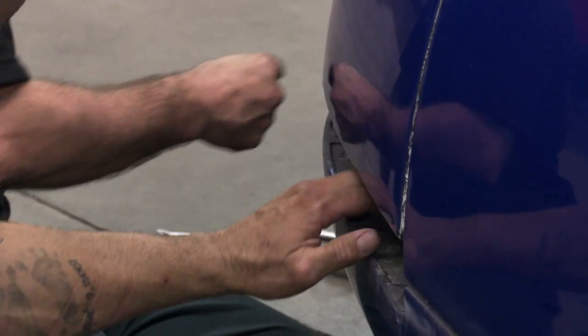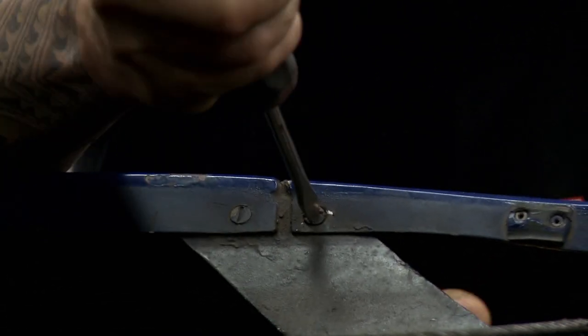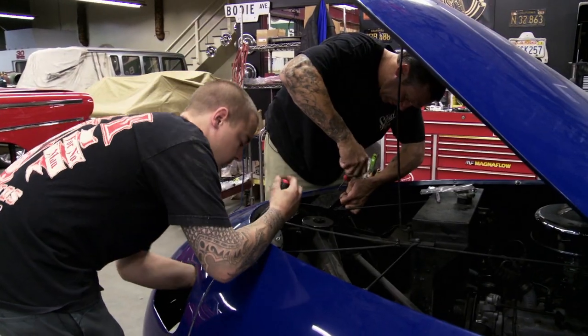Very important that we find the actual factory color. I'm not seeing it yet. When a car has been repainted, you can usually find areas where there's some original paint. The best thing that we could do is start tearing panels off, pulling upholstery out, and really get down to the nuts and bolts of this thing, and see if we can find a piece that didn't get repainted.